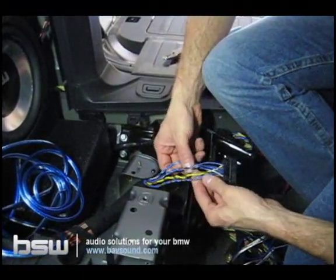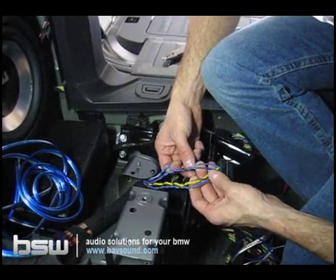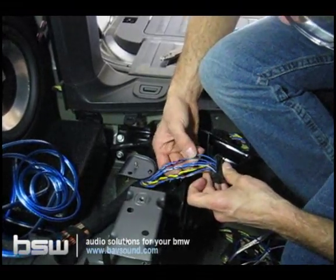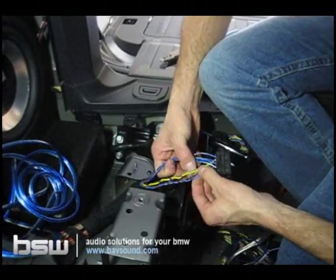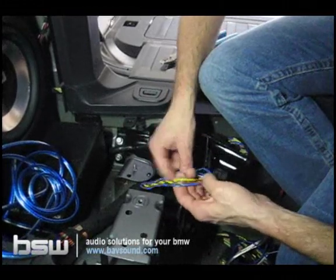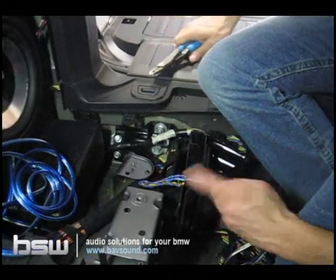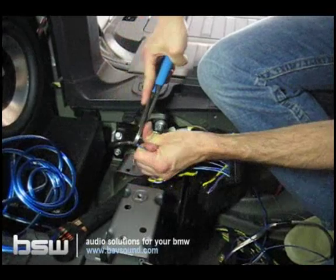We only need 2 of them. On this plug, we've got blue brown, yellow brown, blue red, blue brown, blue white, blue brown. So as it sits in this car, your positives are the solid blue and the solid yellow, and then blue white and blue red. We're just going to use the blue and yellows because it's easier. So just take them, cut them, like I said, a couple inches off in case we need to reattach it. Go ahead and just strip the wire.